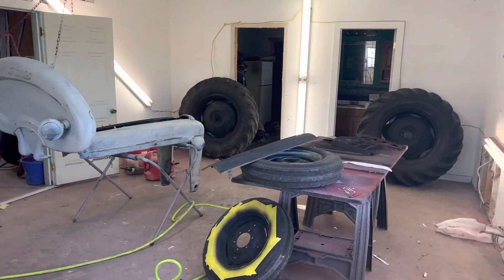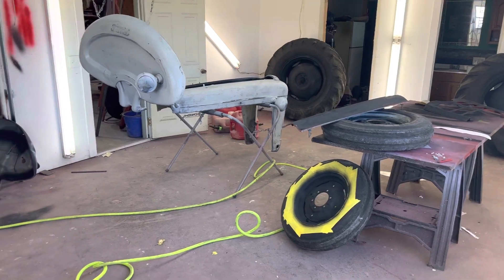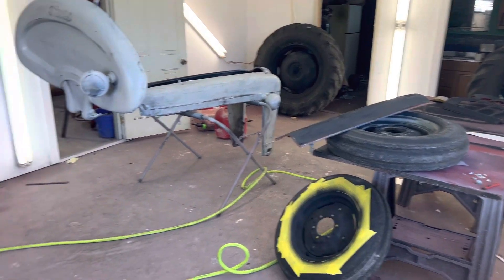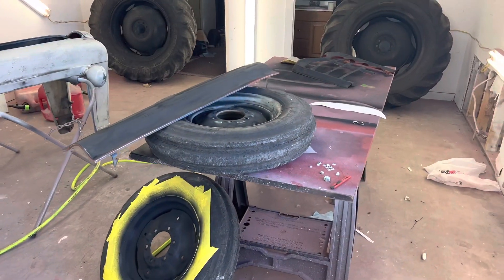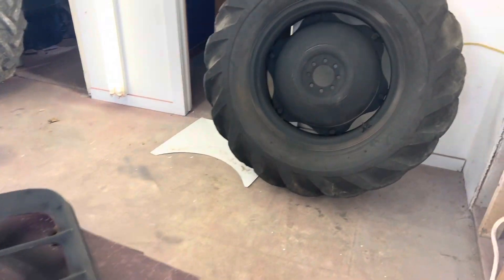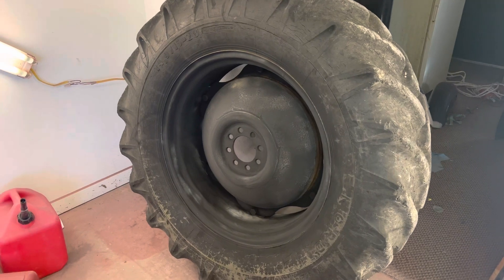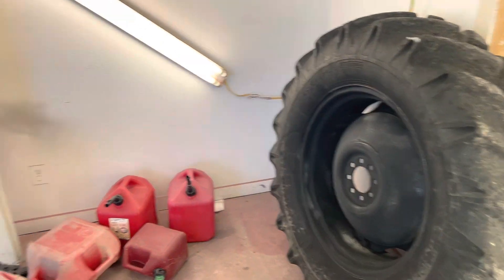We went over this thing lightly and sandblasted the majority of the flaky material off. I certainly would not call this a full restoration — the owner just wants it cleaned up; in his exact words, he just wants it to look better than it did. So there are as many lessons here for what not to do as what to do. We sandblasted off the heavy material and came back over this with a product called Rust Encapsulator made by Eastwood. They advertise it to destroy rust. I've used it a number of times — I don't know if I'm willing to say it will completely destroy it, but the black stuff you see there is the Rust Encapsulator. I went back over it lightly with some 320 to knock the texture off of it.